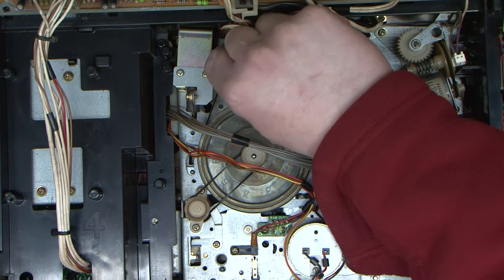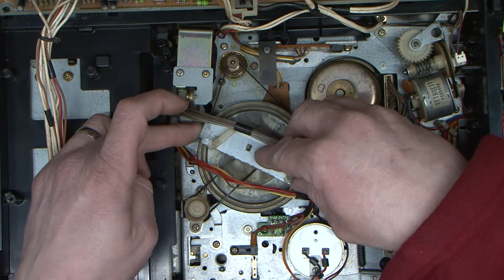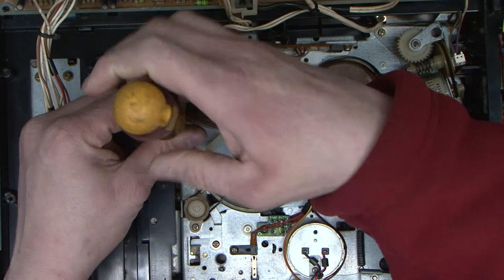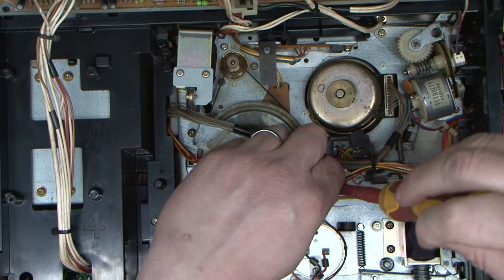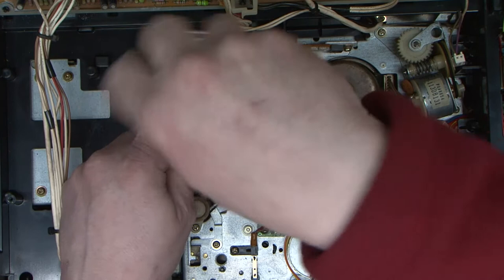So that's back in place. I'll put this back into here. At least now we have a chance that the capstan might turn. If we'd tried this with the tape straight off, it would have just not worked. There's a lot of these floating around on the internet that are described as untested. Okay. Well, so that's the capstan belt done, and this belt here.